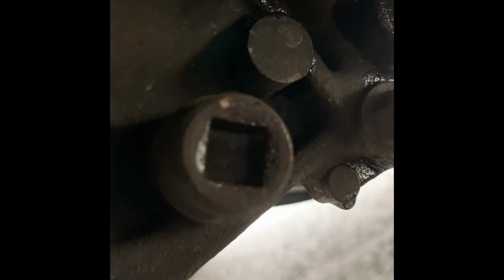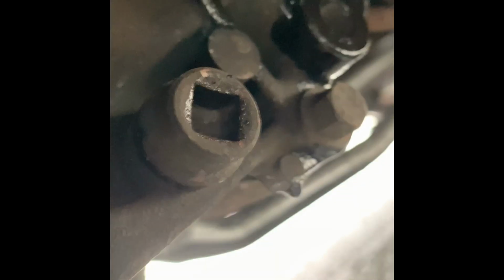But I may as well just go the whole hog and use the drain plug. You don't have to use a special hex key thing. I used the 3/8 ratchet, and it was surprisingly easy to undo. So, little tip for you: you don't need to buy a special bolt or socket to undo it. A 3/8 ratchet will do. I'm going to use my high-tech draining can, and we'll see what colour it is when it comes out. Now that I've drained the oil, you can see what sort of state it was in. Yeah, black.